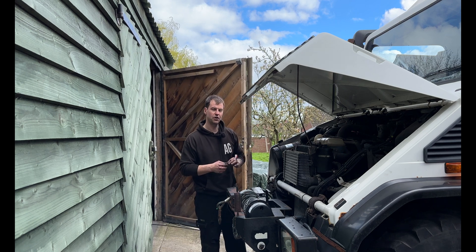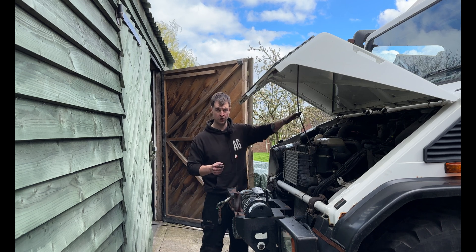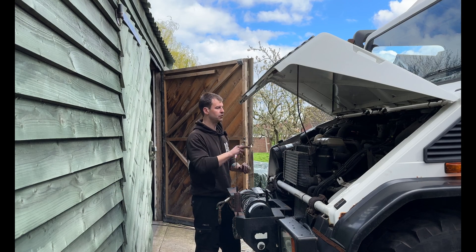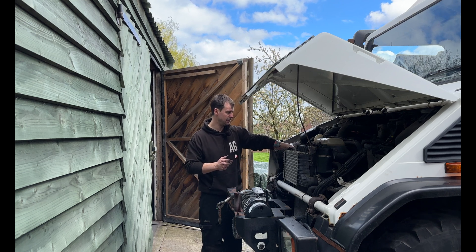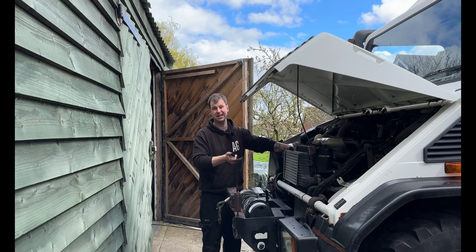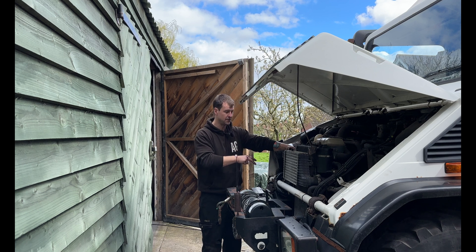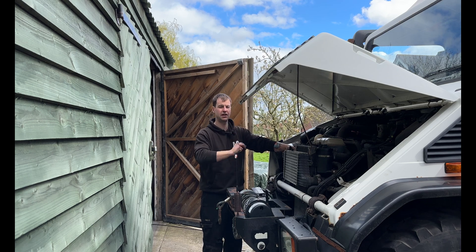It's now time for another test drive in Smog. What I've been doing is checking over all of the vacuum lines. I've traced back the ventilation one behind the dash - that is absolutely fine, cleaned it out, everything is hunky-dory. The other one I've traced is a little gray line across the top which goes onto the front of the engine block, drawing vacuum directly from the engine. What I've done is actually taken the EGR solenoid out of the situation so it's going straight to boost. If for whatever reason the EGR is taking off too much vacuum or more than its fair share, that could reduce the boost because it's not got enough to hold the vacuum open. Taking it out of the equation so I'm just focused on the boost for now - a quick test drive should eliminate any problems.